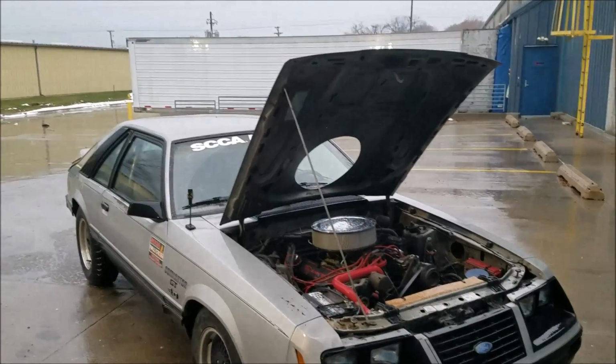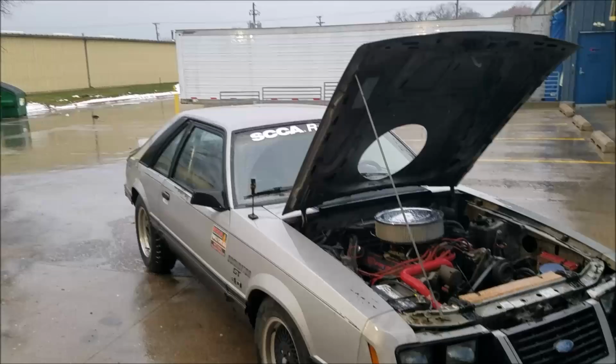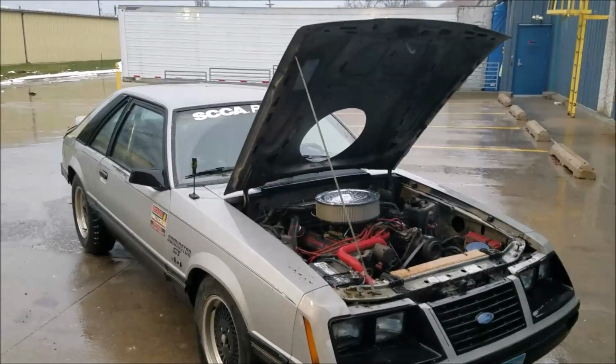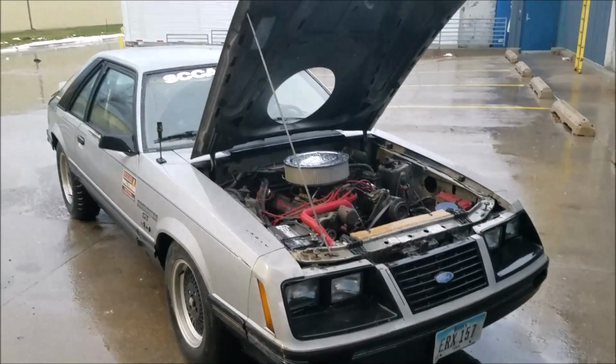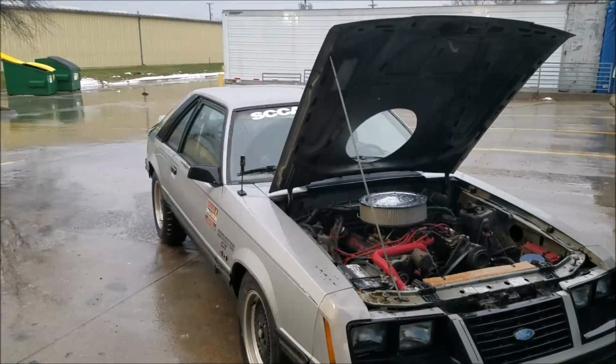But yeah, I just want to make a little video there and keep you all informed of some of the things I've seen, so you don't make the same mistake that I almost made. Again, luckily my engine was worn out enough that it saved me. But yeah, 20/50 oil in the winter, definitely would recommend against that.